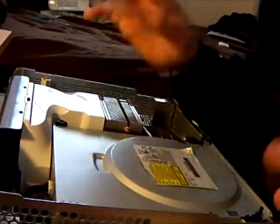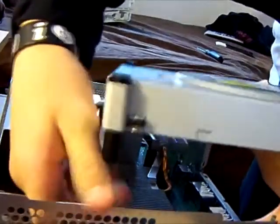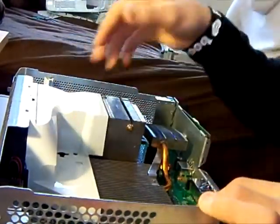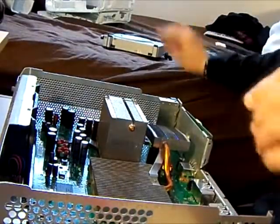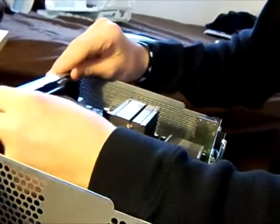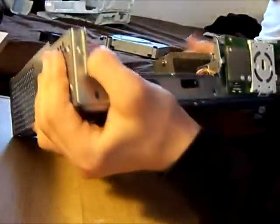There, you've got your motherboard. Now you want to take your DVD drive out, so you're going to pull it up and you'll see the cables in here. Just gently take them out. Nothing too special — just put that over there. You want to take this out too; if it doesn't come out, get your knife and unlatch it — there's a little latch in there. Now you want to take your fan out back here, so unplug it, lift this up, and take your fan out.